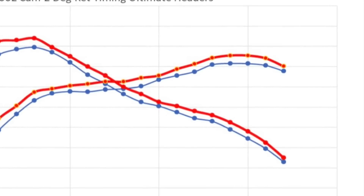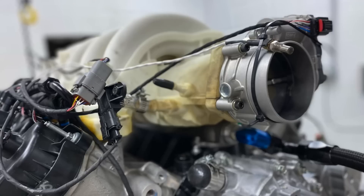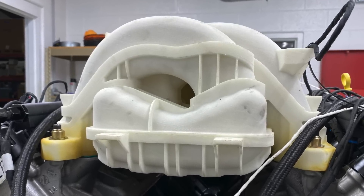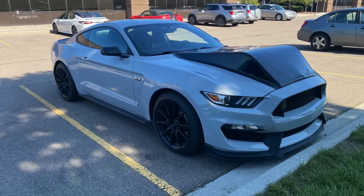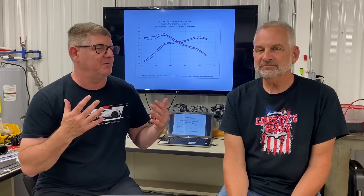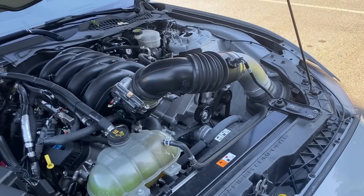So for something that's designed for easy packaging, I was really impressed with the results. I think people are going to be really happy, because a lot of people just said, 'Give me something that doesn't lose any torque and will package.' And this actually picks up torque, packages, and picks up horsepower. The curves are behind us — you can see that the red line, the line above, is the Ford Performance intake with the Ford Performance throttle body versus the stock, which is the blue line below. If you saw the video we did on the 7.3 in the Mustang — taking off like wildfire with the big rhino hump on the hood — the first priority for Ford Performance was to solve that problem: make a manifold that actually fits in a car where you can have a normal hood.